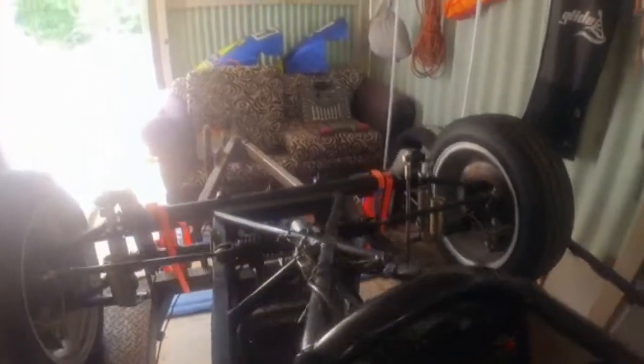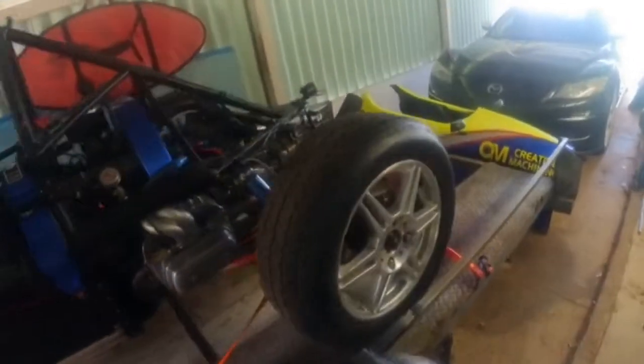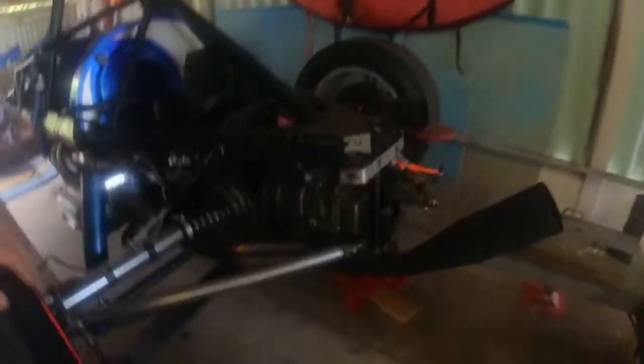So that means somewhere along the line, it's this green one there, runs all the way down the chassis, out there, this is it here. Somewhere along that it's grounding to the chassis, or we've got a faulty sender. So last night I took all this off, checked it all the way up into that harness. It was all good, which means our sender's faulty. So we're going to take that off.